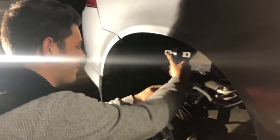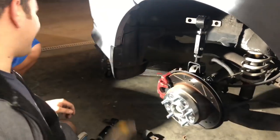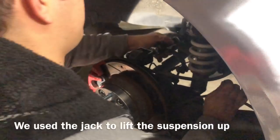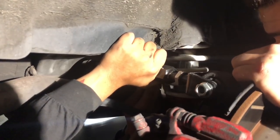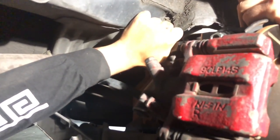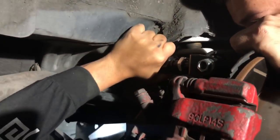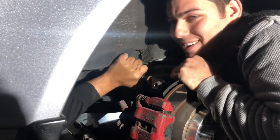This is a little bit too small to go over the stock bushing assembly, so we're just gonna open it up a tad and then it'll slip over, then retighten it when we put the bolt in. Make sure the oval is on the left, just how it came out of the car. I put one of the legs into a vice and pulled it open a little bit on each side, then hammer it to get it over. This is a cheap camber kit — if you get a good part you won't need to do this.